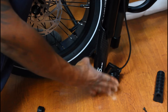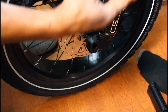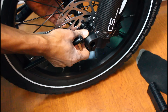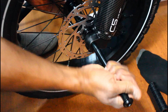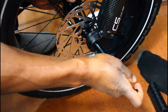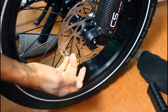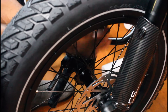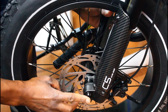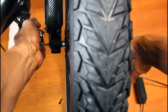We're going to put this axle in, and the front fork size rotates, so I'm going to rotate this part of the front fork to make sure that the brake is towards the back. On the other side of the front fork you can adjust the height. We have to make sure both sides are aligned. I got my boy holding the bike up, going to put the axle through — okay, got that through. Now tightening up the axle on both sides; you will need two hexagon wrenches to tighten it, just like you needed two to loosen it.